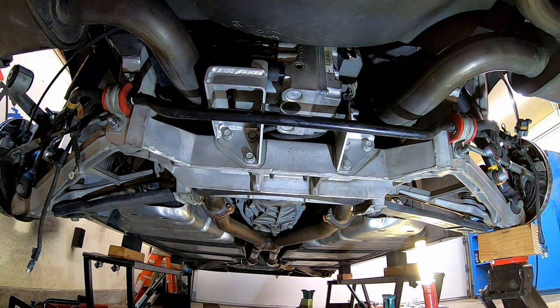I think probably not going to turn the camera back on until we start this thing up, and maybe bring y'all along for a trip around the big city block, to start breaking this clutch in. Monster says, I think it goes for all of their clutches, but they basically want 500 miles of stop and go traffic before you start pouring the coals to it.